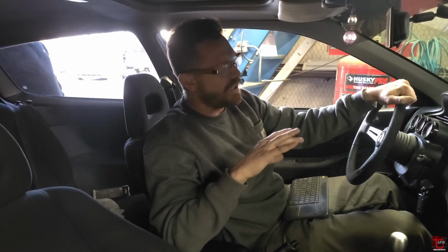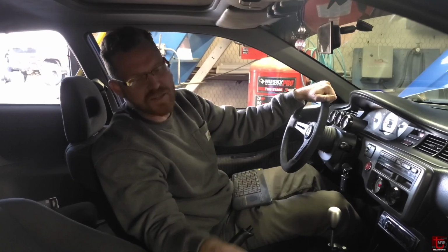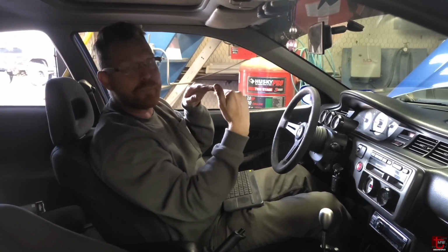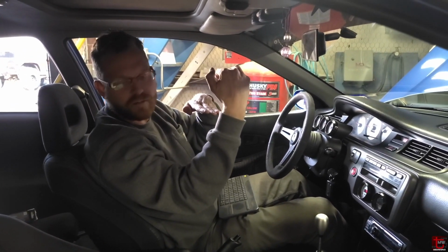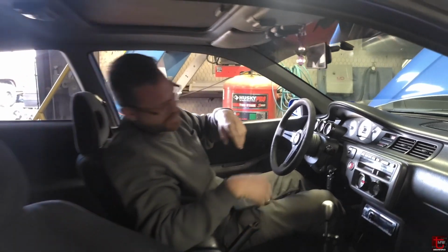That was right on the borderline of concern. We were still in the 11s, but it looked like it was going up, so I decided to stop it. I'll add in just a little bit more. It looks like I need to smooth it in though, because now I'm getting a pretty big jump in VTEC. So I'm going to increase the low cam leading up to it, and I'll come over here and show you on the log what I mean.